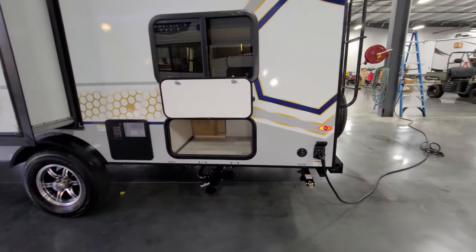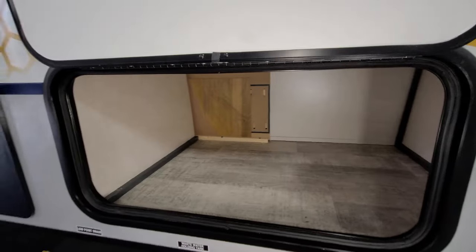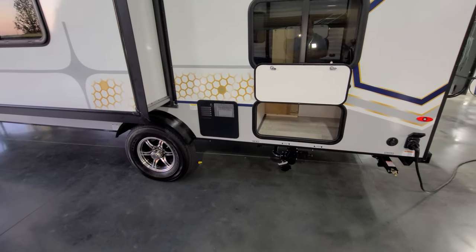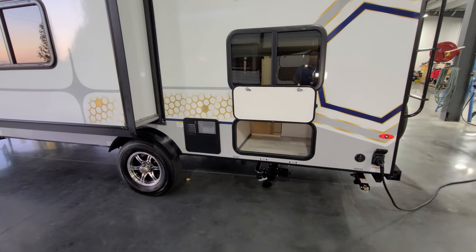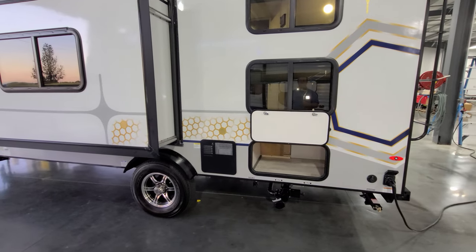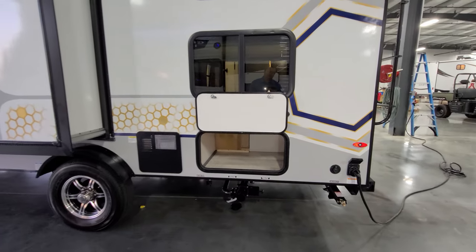Next to that is your cable and satellite inlet cord, so you can hook up to a campground's cable if they have it. Over here on the left, this little wall is a panel that comes unscrewed to get to the back of your six-gallon gas-electric water heater. That allows you to bypass or un-bypass it for winterization and summerization steps. Flipping down the door of the water heater, you can see the one-and-a-sixteenth-inch drain plug in the lower middle, the electric switch in the lower left, and the pressure relief valve in the top center. Relieve the pressure before you try to drain it. Make sure there's water in it before you turn on the electric switch or you'll burn up the heating element.